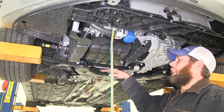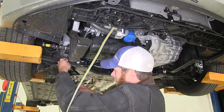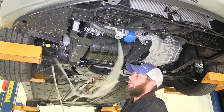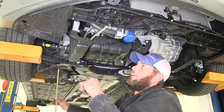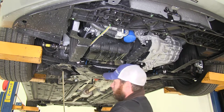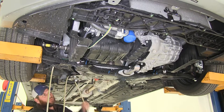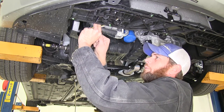While we've still got our underbody panel off, we're going to route our wire basically right back in this direction. I want to have it up and supported so that even if it gets pulled on, we won't have to worry about it hitting any moving parts or sharp edges. Right back at the rear control arm mount, we'll hop right over the top of it. Anywhere we can along through here, we want to anchor it off.